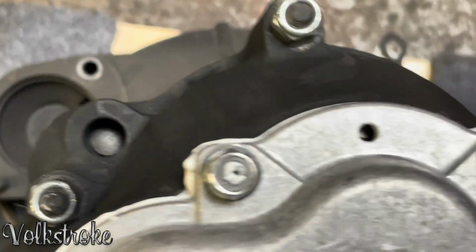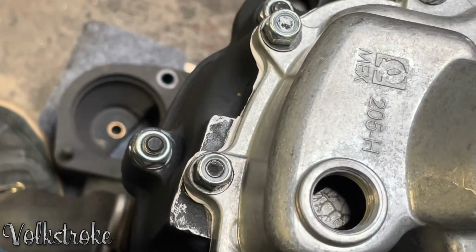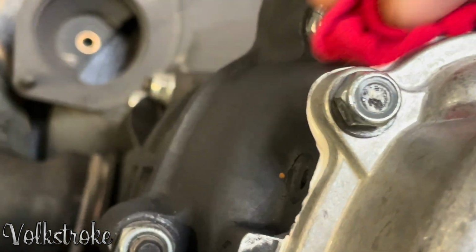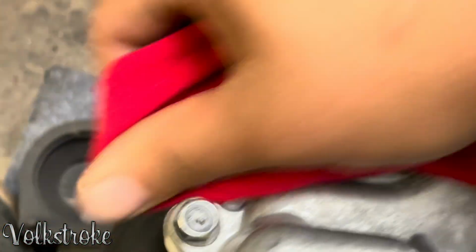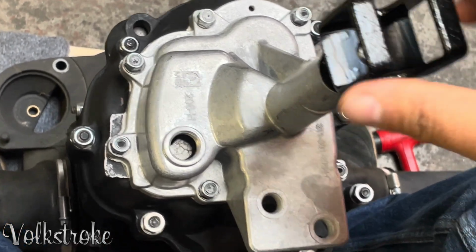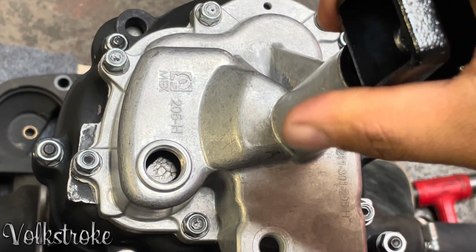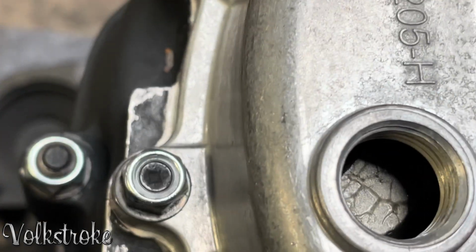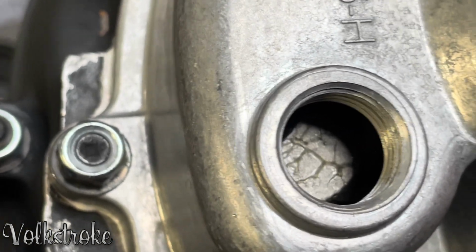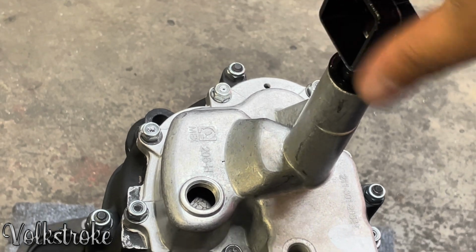That's the vent hole. Cool. Now, you don't have to, but I like to clean the silicone off. All right, so you don't put any channel locks or anything like that, but you still want to test it. I put a shifting coupler, and you can make sure that it's still in there, and then put a little bit of pressure on this one, and you can see it move right here. Anyway, I know it's in there, and that's it. You're done.